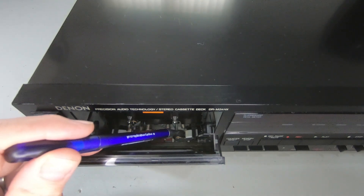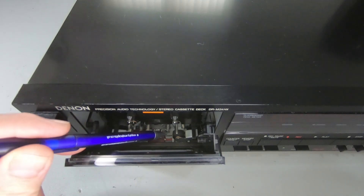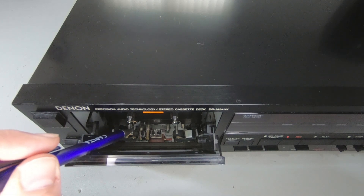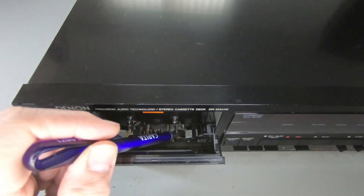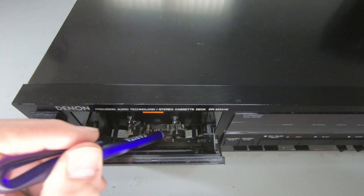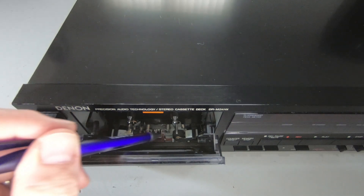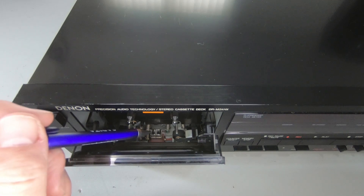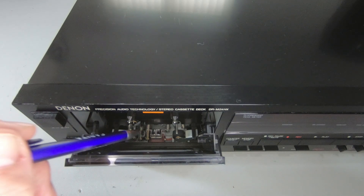This capstan here determines the speed of the tape across the head — it draws it through, pinching it between the pinch roller and the capstan. With a closed loop dual capstan, the closed loop refers to the section between the first capstan and the second capstan. It pinches the tape before and after, and it also stretches the tape ever so slightly to ensure there are no ripples or bumps. The tape isn't loose across the cassette head — it's taut and pulled just across that head as it goes across, ensuring a bit more stability so there's no chance of that tape lifting up at all.